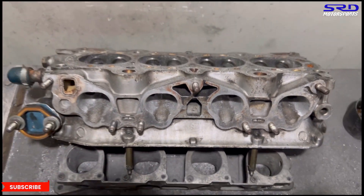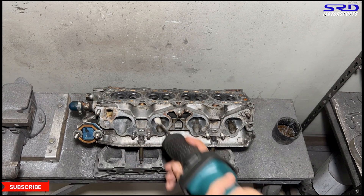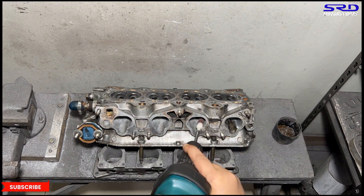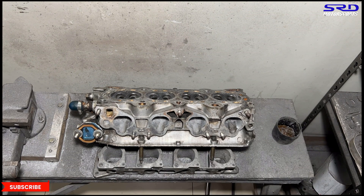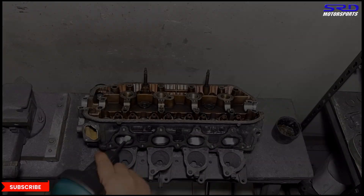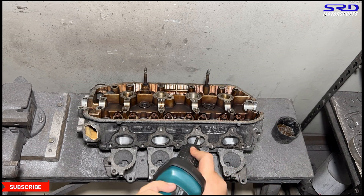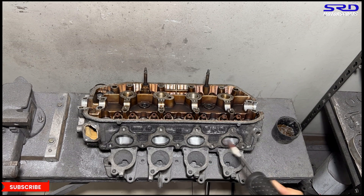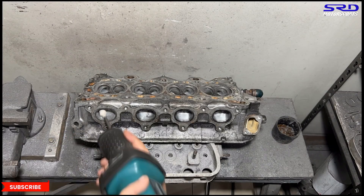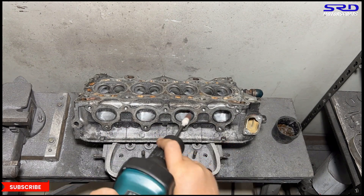The port alignment is looking really good. Now let's go with the roof of the intake ports — we're going to blend it onto the side walls. The floor is already blended well, so we're going to connect all that. Now let's move to the exhaust port and work on the port floors. It's starting to look good. As mentioned in the other video, it's more critical on the port roof of the exhaust because flow naturally pushes upward when it exits the chamber. So we're going to get this shaped really well and really good.